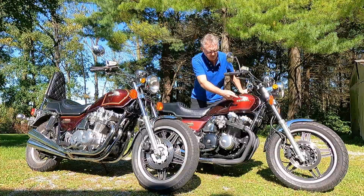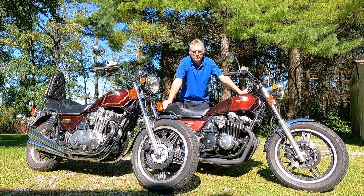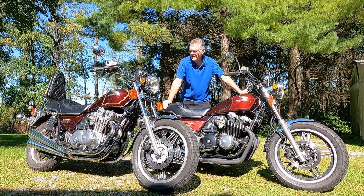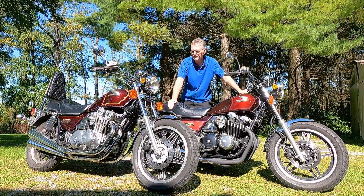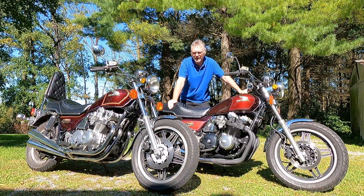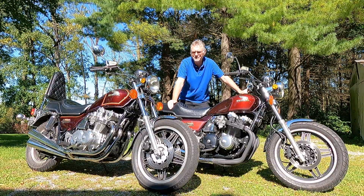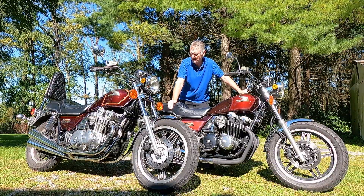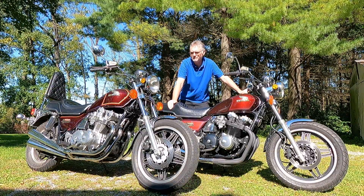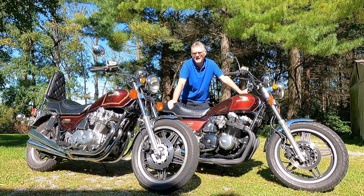In 1982, Honda went to twin-piston calipers on the front brakes. That's really because the brakes they used on the 1980 CB900 Custom were parts-bin brakes, as were the rotors — both off of bikes like the CB750. The brakes on the 1980 weren't quite up to the task of stopping that heavy a motorcycle. The braking was honestly so bad that it was dangerous.